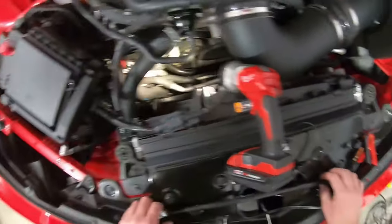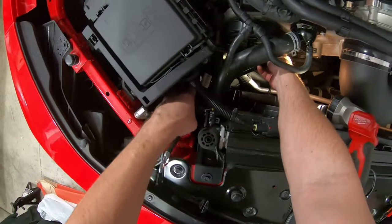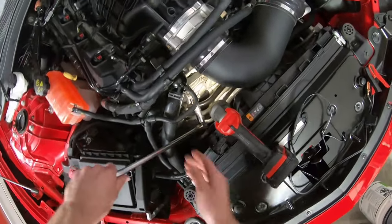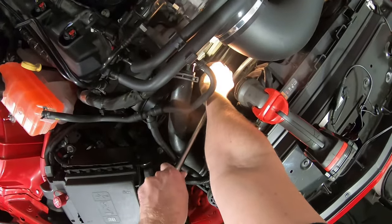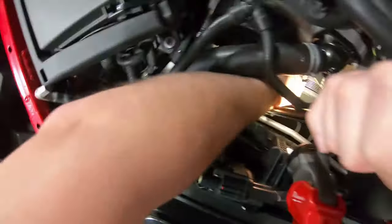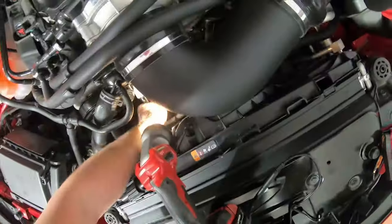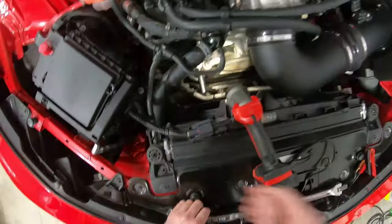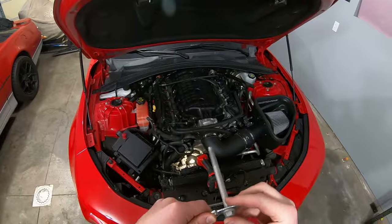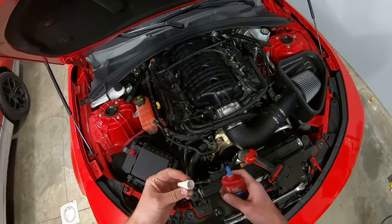We're going to use this tensioner bolt. I'll run the cable right here and zip tie it to some of the other cables. It's long enough at 18 inches. We'll use a 15-millimeter breaker bar to get this on and relieve the belt tension — give it a good short turn and the belt goes a little bit. Then we use the same 15-millimeter to remove the bolt all the way so I can slip my cable lug through. It fits like a glove — that'll work really good.